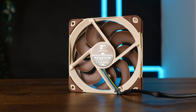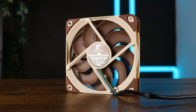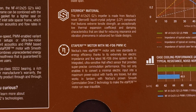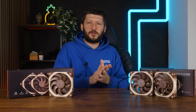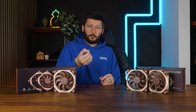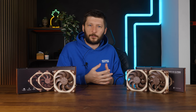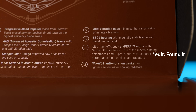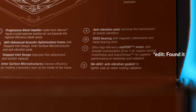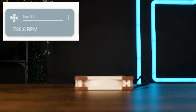We got the exact same central fan hub with these additional grooves, because over-engineering never ends. What's inside the central hub is also identical to the A14 G2. We still got that ETA perf motor with NEFD6 PWMIC, which is just Noctua's way of saying they made the motor even better and even quieter. The Supra Torque feature — the thing that boosts power to keep up with higher resistances like radiators — is not mentioned anywhere on the box, but if you press the fan against a solid surface, the speed crawls back up. So I think Supra Torque is still there.